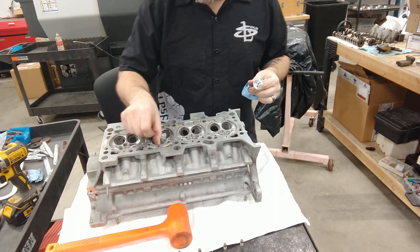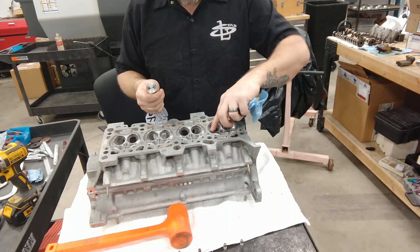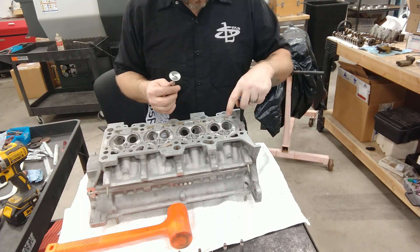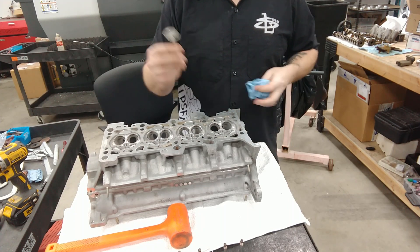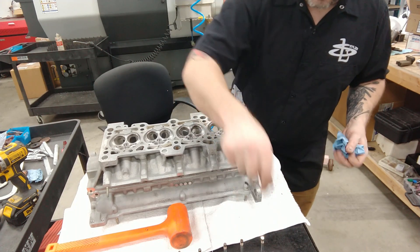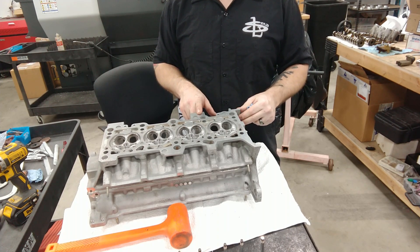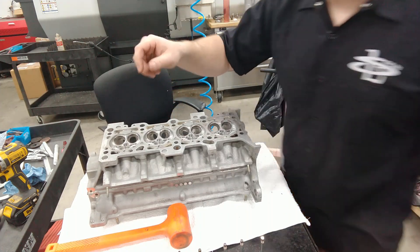If you do have some seats that have some good nicks in them, or like sometimes your exhaust valves — if a motor has been sitting for a while and the valve has been hung up just a little bit — it'll get some corrosive kind of surface on there, corroded and a little bit pitted. You can usually get that out with a heavier abrasive and then come back to the finer abrasive. This head's in good shape so this is working out pretty good. That valve I maybe lapped in for a total of maybe a minute, minute and a half — it doesn't take too long each. It takes longer to probably clean everything up and put grease on it.